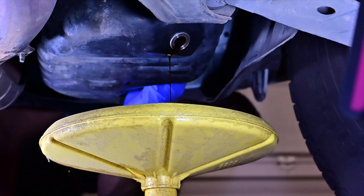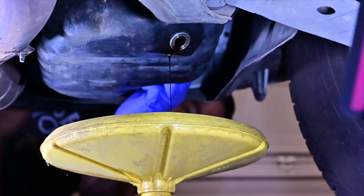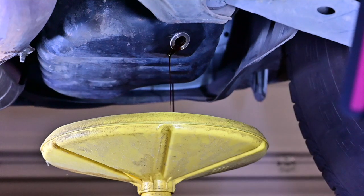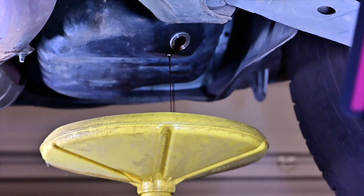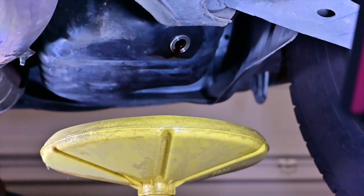Let's loosen this oil filter now. I think it's safe to do it. I don't know if you guys can see it, but here it goes. Things you gotta do to double check, make sure you don't put two washers. So you check your washers, and also check your oil filter, make sure there's no double O-ring, because if that would happen, that's gonna make a lot of mess and it's not good to clean up. It stopped dripping.